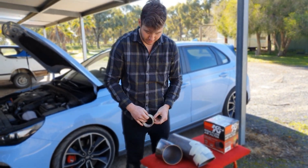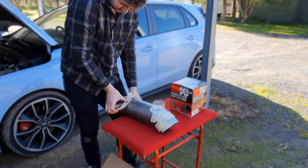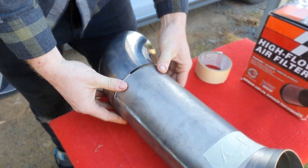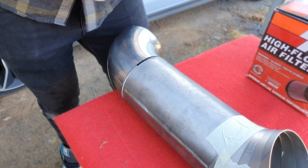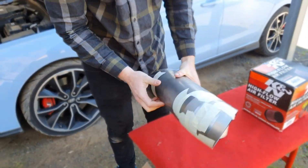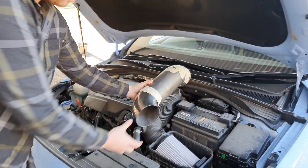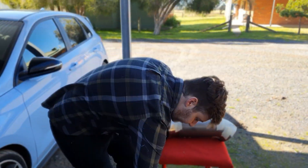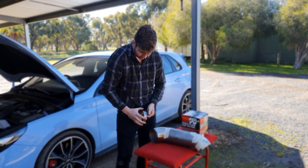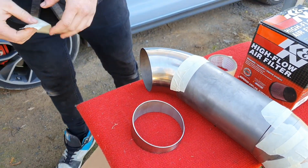It's a little bit off - probably about 70 degrees rather than 90. As I said these are off-cuts. Looking at how she's shaping up, that's going to make the air cleaner sit in there nicely. If I really want to run mandrels I'll probably need two mandrels anyway, because I don't like the look of just having one there - it looks like you've half used pie cuts and half used a mandrel. I don't want it to look like it's made out of off-cuts.